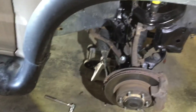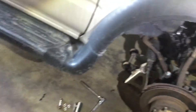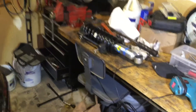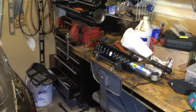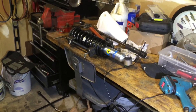This thing slid right out without having to mess with all those extra steps. If you're doing a lift on these using the shock designed for the 4Runner, don't waste your time pulling off the tie rod ends, the sway bar links, and popping ball joints. You don't need to do it — just remove the lower bolt and the upper bolts. After I get this spring swapped out, I still need to tighten things down and change the clip on this one, but I'll show you that I'm not removing any of that stuff and this thing will slip right back in without an issue.